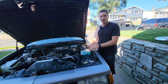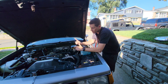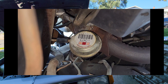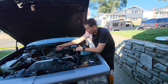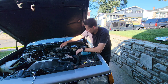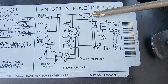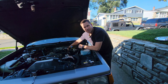So here we are over on the driver's side of the car. It's a very simple system with really only two main components: first being a thermal vacuum switch that you'll find in your intake manifold, and the second being the actual EFE valve itself. The EFE valve will close when the engine first fires up and is cold, and will then redirect a small amount of exhaust gases back up through the intake manifold and out the other side to heat it up a lot faster. The thermal vacuum switch draws manifold vacuum from a T in the vacuum system, then goes to a very small pipe and runs down to the actual EFE valve, which is located right below the driver's side exhaust manifold.